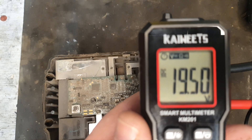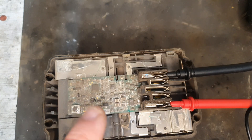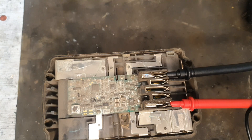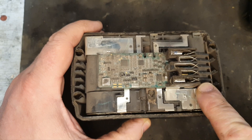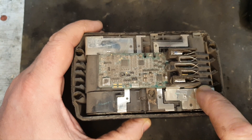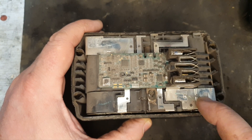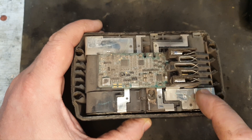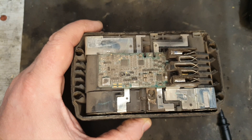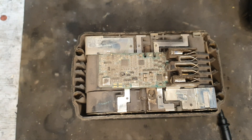Putting the meter on the overall voltage of that battery, it's 19.5 volts which should be good, but it's not in this case. I always make sure the connections at the top of the battery look right — that strip there acts like a fuse. Should there be an overheat in the battery, it burns out before it overloads the cells.